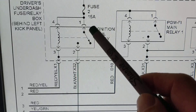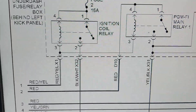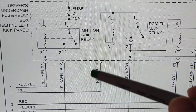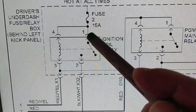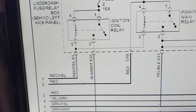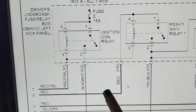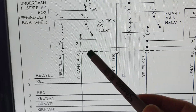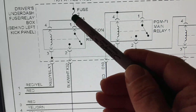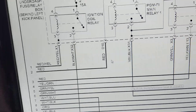If 12 volts is here and this goes to the computer, the computer gives it a ground, so it'll be at zero volts. This side will always be 12 volts — it goes to the battery hot at all times. So this always measures 12 volts regardless, because it's connected to the battery. The point of attack — where I put the voltmeter — I put it right here. That spot, in a nutshell, tells me if the whole relay is working in one shot. If I have 12 volts here going to the fuel pump, that means the whole relay is working. I demonstrated this in the video on how to check relays in-circuit.